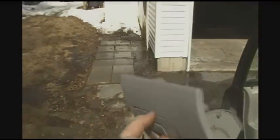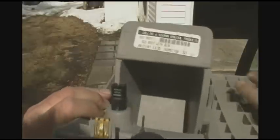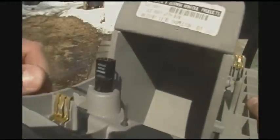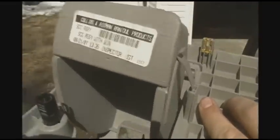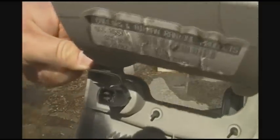And you're going to see the connector here. Here's the panel outside the car. This is what the switch looks like when it's in the panel. The way it comes out here, see a little tab here, but you use your pick. You're going to push it in with this, just like so, once you get it below the rim there. You have to do the same on the other side, but remember, you'll have the panel popped out already. Here's the other tab that you're going to press in with that pick.